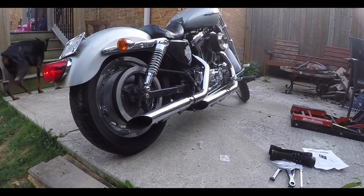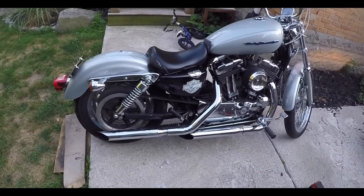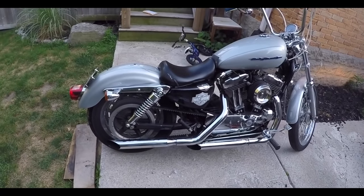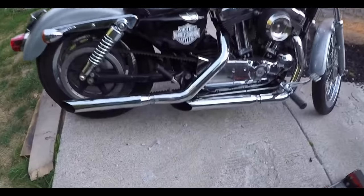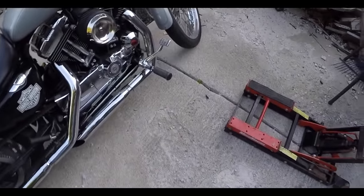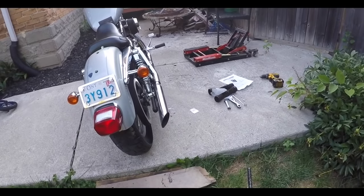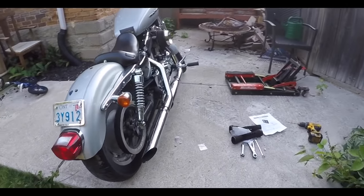I'm watching my girls tonight so I won't be able to take it out for a ride test, but tomorrow on the way to work I'll give her a shot. If I'm not happy then I might have to add the original baffles back in. One tip: if you're going to install new holes, make sure you leave enough room in case you want to put the baffles in too. My baffles sit just a little further in than where I put the inserts, so it should all work out.